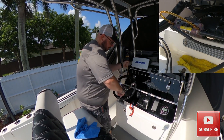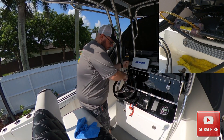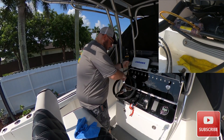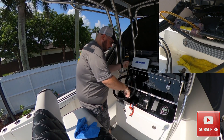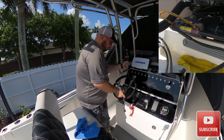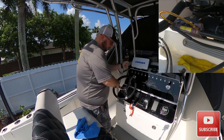It's going to get to a point where you're not going to see any more air bubbles. Once you get to that point where there are no more air bubbles, you already know the job is done — you have nothing but fluid inside the pump, no air bubbles. It's always good to give it an extra couple of turns back and forth, making sure your chances of having air bubbles in there are eliminated.